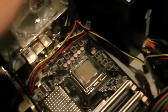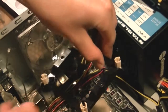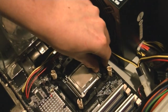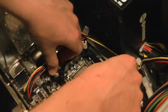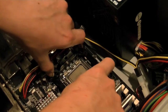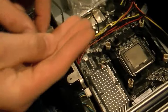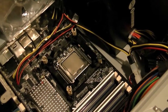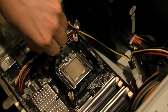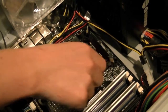Now, what you do is you put it on your motherboard. In the manual it shows these screw holes being closest to the top of the motherboard, but you don't want it like that. You want it so that the screw holes are oriented like so. You just push these things down to each of the holes — they don't snap in quite yet, so it's not going to offer any resistance. Now you take these little black tabs and insert them into the top of each of those tan tabs. It shouldn't make a click, but it kind of firmly inserts. And that's it for the mounting installation — that's in there nice and tight, not going to move anywhere.